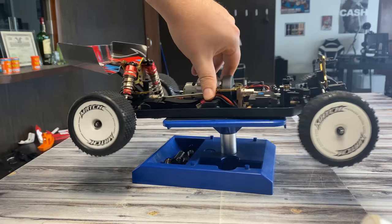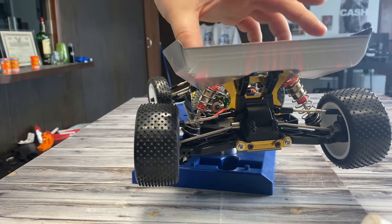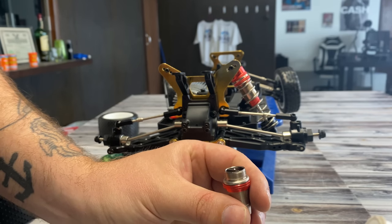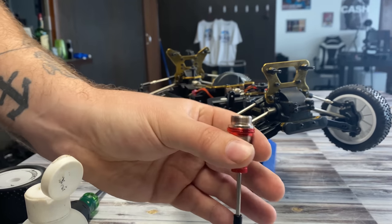I'm going to take off the other one and make sure it's the same. The other shock looks pretty much exactly the same. Not bad. I'm actually going to add just a touch of grease to the bottom here, and that will hopefully help seal the bottom seal so we don't have any oil leaking out, because shock oil is expensive and it's getting kind of hard to find these days. So we definitely don't want to lose any. I got it up on the stand — let's flip it around to the back. I'm going to get this wing off and then we'll take a look at the rear shocks. Pretty full. Feels good. Looks good. Awesome.